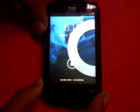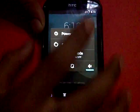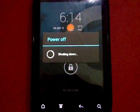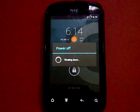First of all, turn off your phone — power off. Set it down, and after doing that press the volume down key and the power button together. It will boot into recovery mode; it takes a bit of time.